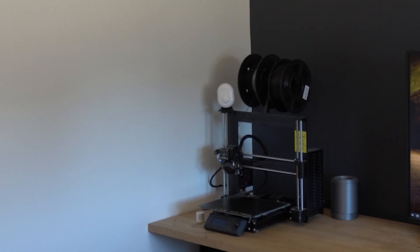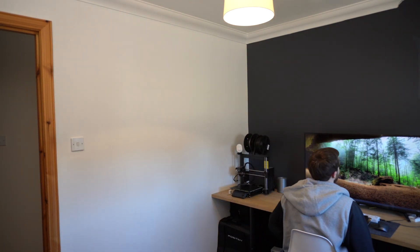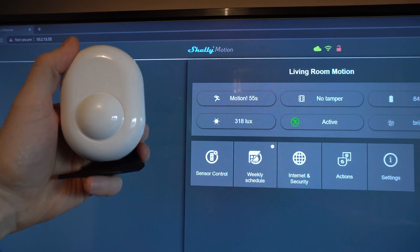Now let's get into the motion sensor performance. Shelly claims it takes less than 200 milliseconds for the Shelly Motion to wake up, respond, and trigger another device. I have no way of verifying that, but as someone extremely sensitive to delays — especially with lighting — I am more than happy with the response time. The 256 levels of sensitivity are an excellent addition to dial in your environment. Even with a minimum blind time of one minute, the sensor still detects motion during the cool-down, resetting to 60 seconds on each trigger, and the motion LED on the front confirms this. The hardware seems capable of detecting about every three seconds — so it appears to be a software limitation.